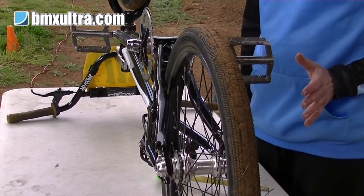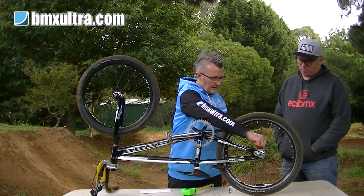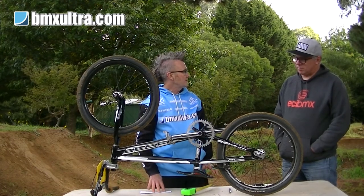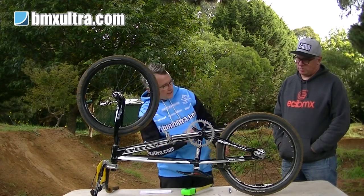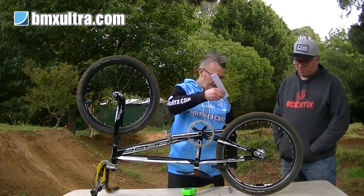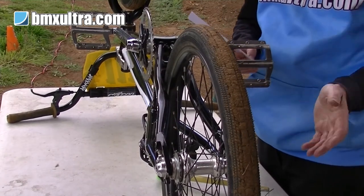With your standard Shimano pattern cogs, there's a series of spacers you can get to fit behind the cog. You can move the cog in and out to adjust, and that's why using this method when you're building the bike is a good way, so you're not setting it up, putting the chain on, checking the alignment, then taking it all apart. While the bike's in the build-up stage, you work your measurement out, you need your 13 mils, you go to line it up, and the cog's way over here somewhere. Okay, I'll quickly make a mark: 2 mils, I need a 2 mil spacer in there.